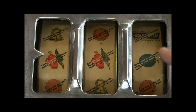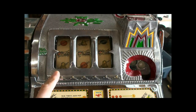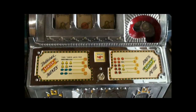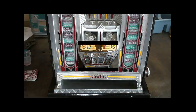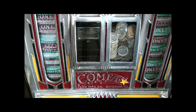I've got this machine coined up and in the middle of a cycle. I've stopped the clock motor and adjusted the reel so we're set to pay the big jackpot, which will pay 20 coins plus one of these two jackpot windows. Let's release the clock motor and watch what happens — jackpot! The very next play will close the jackpot door and allow that to start filling back up again.